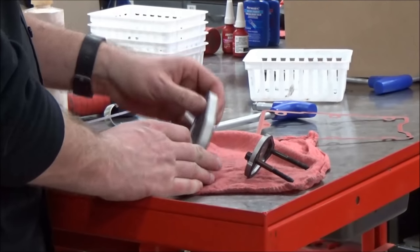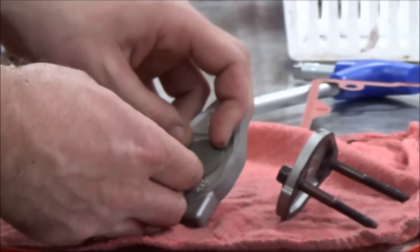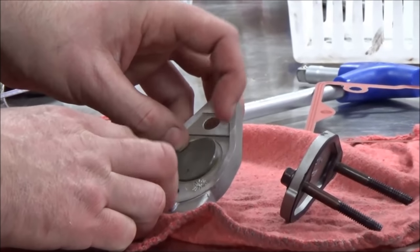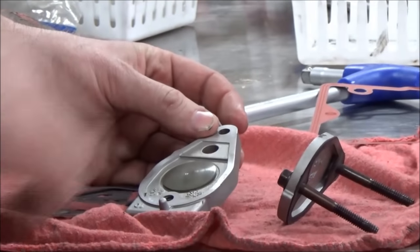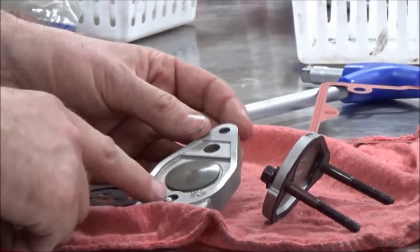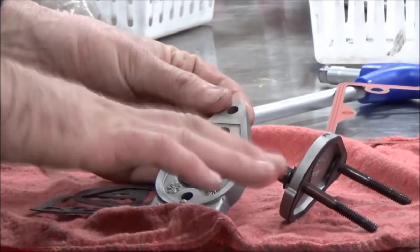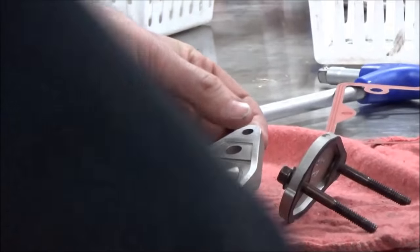If it does get through here, what we're hoping is that the very last thing that gets through is literally going to be air. So air will come through here and circulate through, and there's always going to be some oil that goes with it. So we hope it's still going to change direction and drain back. But ideally, this passage here, then the air, which hopefully is just down to air, will go through this hole. Now let's go back down to the engine here.